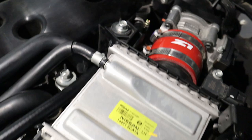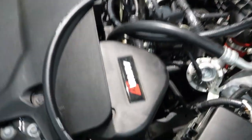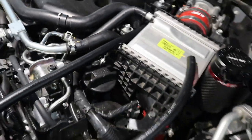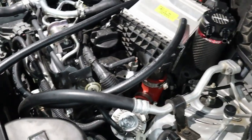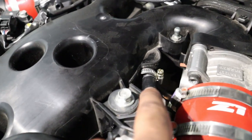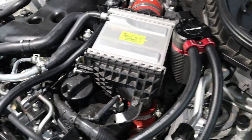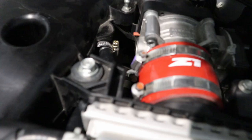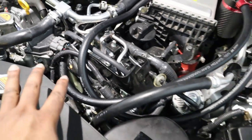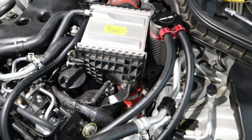Pro tip: if you're having a hard time getting the hose into the inlet, take the oil cap off and cover the opening with painter's tape. What worked best for me was disconnecting the catch can from the bracket, feeding the clamps and hoses through first, then finding the best position without the restriction of the hose already connected. The PCV side is hooked up, the manifold side is connected, and we just need to reconnect to the catch can. The installation is complete — outlet goes to the manifold in the back, inlet goes to the PCV up front. I'm still undecided on the final hose routing but it looks pretty good.